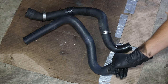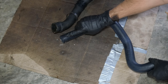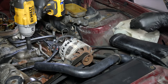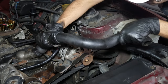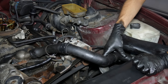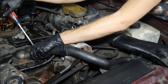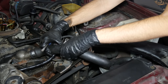With the new thermostat installed, it's time to replace the upper radiator hose — only there's a bit of an issue with the new one. It's kind of close but not the right one at all. Because of where it sits in relation to the alternator, I'm not sure the old hose is right either. We test fit it and sure enough it lines up with the guard on the alternator, but it doesn't work with our thermostat housing. We even popped the thermostat housing off and tried a different small block Chevy one with no luck. We decided to reuse the old hose — it appears pretty new and in good shape, and it fits better than the replacement, which I suspect might be one for the TPI model of this engine.